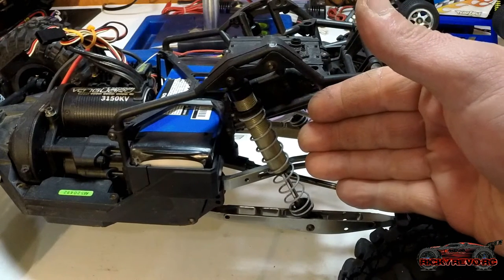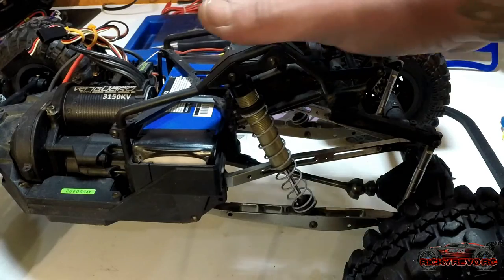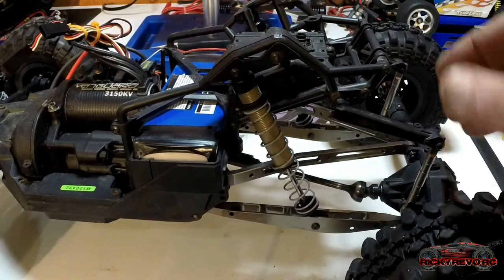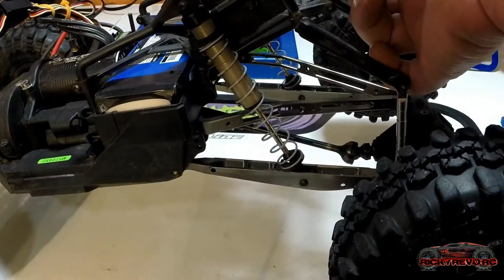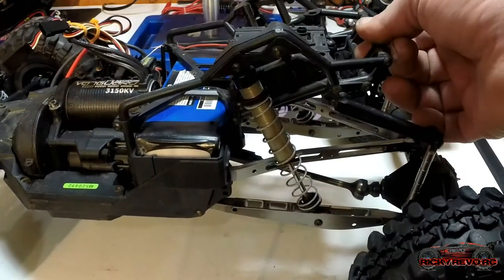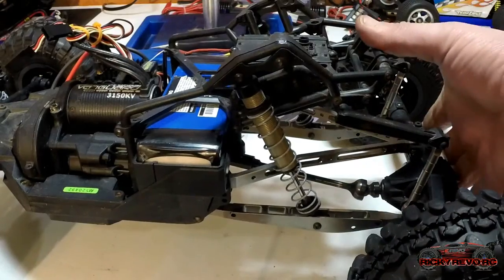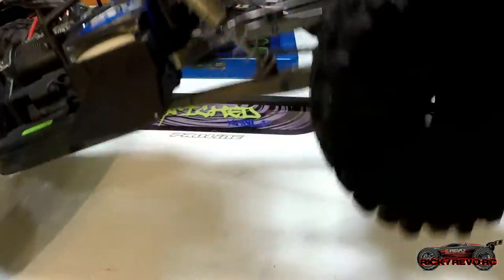Let's look at how I have the suspension set up on my Yeti now, which I'm pretty happy with. I probably went through three or four sets of springs. What I do is put the springs on, settle the car, then lift up on the chassis to make sure I have some stored energy and up-travel in the shock and spring. I set it back down, let it go, make sure everything's sitting nice and the car is holding the vehicle weight at a decent height, then cycle it a few more times to make sure it's smooth.